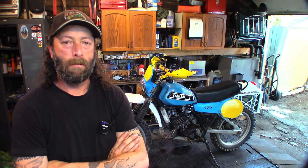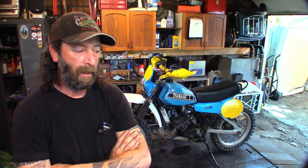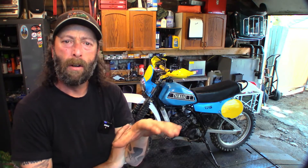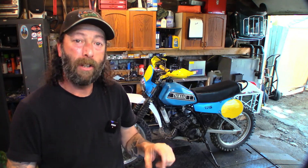Hello viewers, welcome to another video. Today we're working on my old vintage Yamaha. It's 41 years old and it's time to do a clutch on it. I've had it apart before and the clutch basket's got some grooves in it. A couple of issues: if it sits for a while you pull the clutch in and hit first gear and it lurches. If you don't have it revved up it'll actually stall the bike, so it's sticky the first couple of times you use it, then it clears up. It does tend to slip in fourth, fifth, and sixth when you're up in the power band. It's due for a new one.